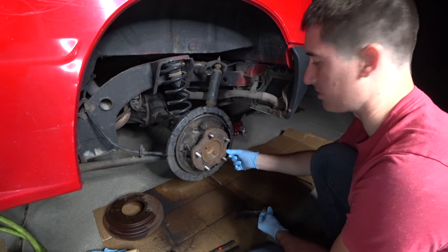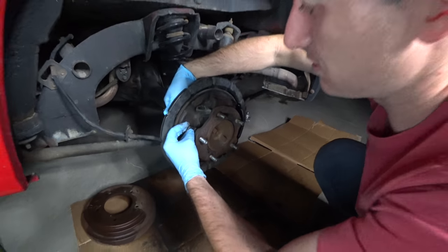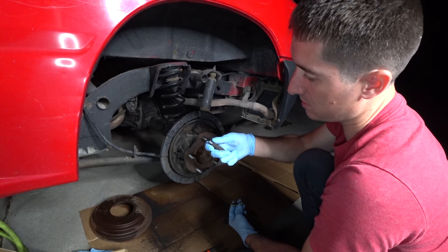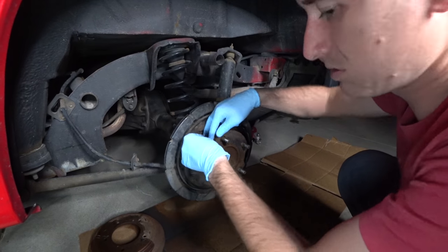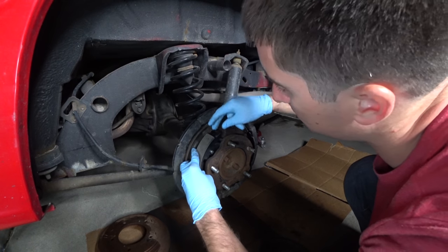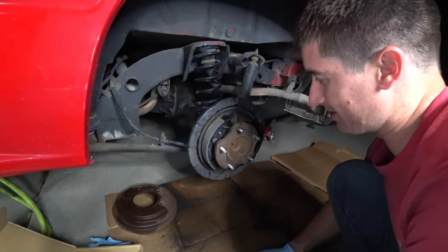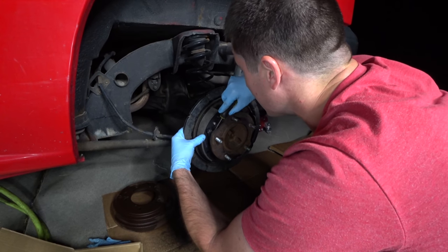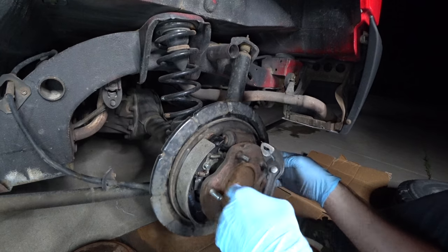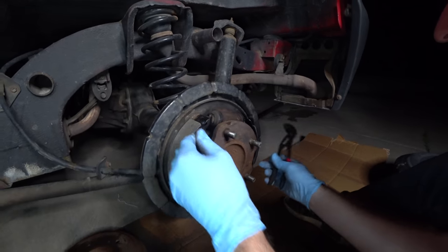I've got the first shoe on now and the retainer clip is in. To do the retainer clip, you just put it on the pad like this, then push down and turn it 90 degrees until it sticks in that slot — those are relatively easy. Here's our adjuster — run it all the way back down so it's set up for new pads, and I'll leave it just slightly loose. Now to put in the new pad. Getting the adjuster all lined up is kind of the tough part. Now we can start putting all of our springs back in to hold this thing together, then get behind our drum brake piston. This is always the fun part — I do have a drum spring tool, but I can usually just get this done with some pliers.